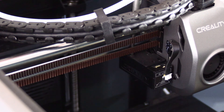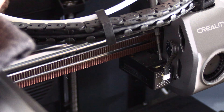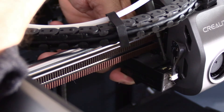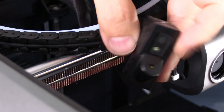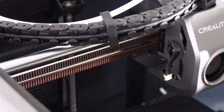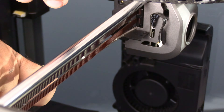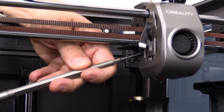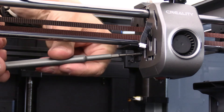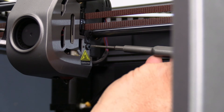With as little pressure as possible, remove that screw. Screw number two is hiding right here. Do support the LiDAR — when the screw comes off the LiDAR will fall. This is what your LiDAR looks like. With the LiDAR removed you now have access to both cover screws. It's almost impossible to see, but there is a screw under this plate right here. Go ahead and remove it. There is another screw right there — go ahead and remove that as well.